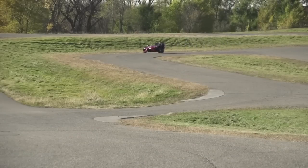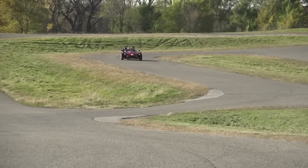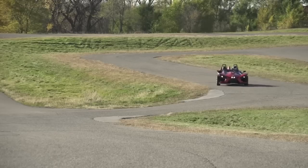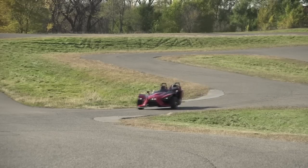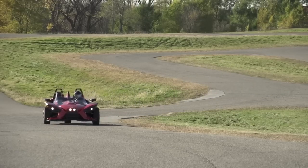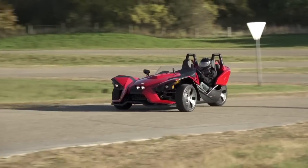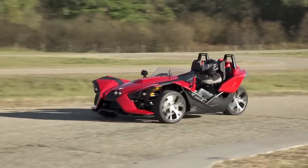Within the recommended speed ranges found in your owner's manual, you can downshift to slow the vehicle or to increase torque. You may want to downshift when climbing a hill or passing. Downshifting also helps to decrease speed when combined with releasing the throttle pedal.